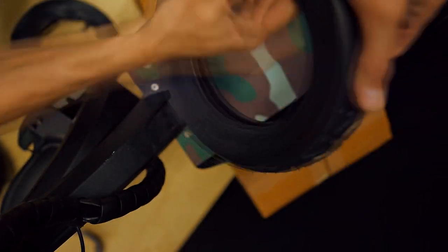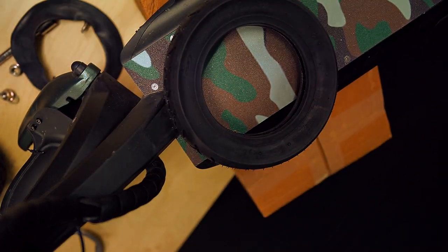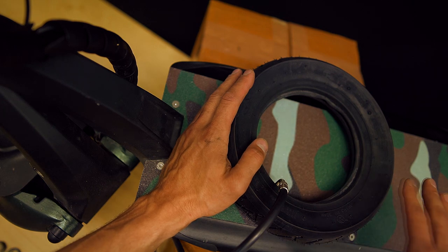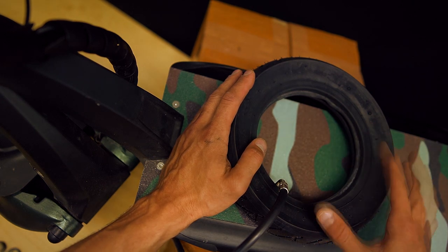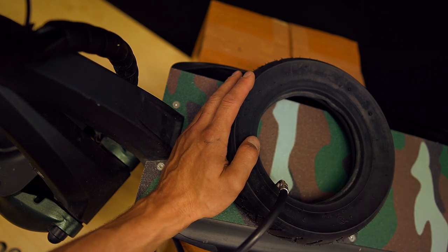It's time to check the tire before you put it on. Check the side wall for sharp objects, make sure it's nice and smooth — this one is perfect. Before the final installation, make sure to put a little bit of air into the inner tube; I find it easier to install a new tire this way.